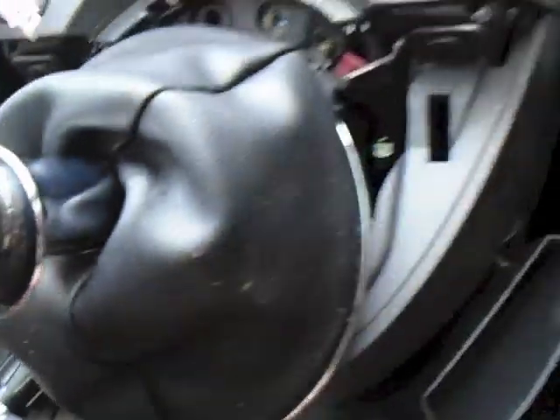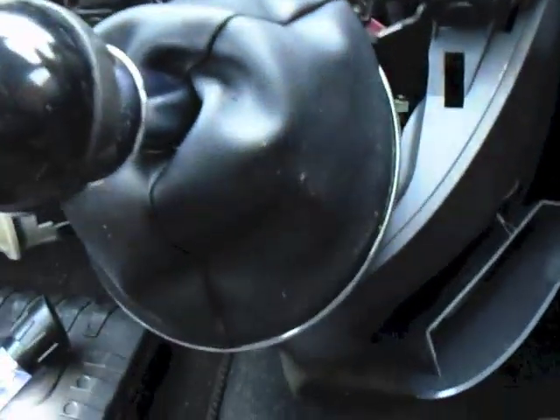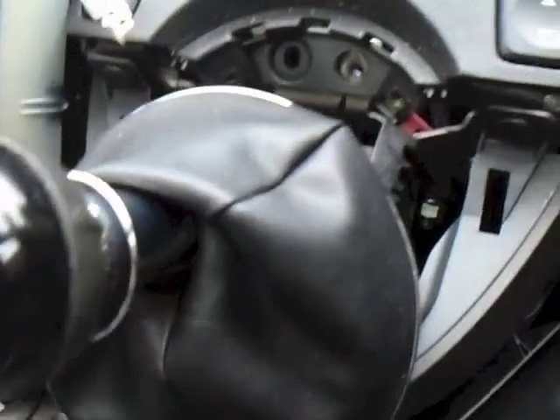When you get that bit off, which is a bit tricky, you have to put it into reverse gear to get that one out, then second gear to get that one out, and use a screwdriver on it — quite awkward. Then you have to prise it off; it's held in various places. Use one of these plastic tools to prise it off. There is a chance you'll break it — I haven't broken one yet but it comes close; they are quite tough. Once the last ones on the centre console are off, those will disconnect and we can take that away. Then the next thing to do will be to get that tray out.